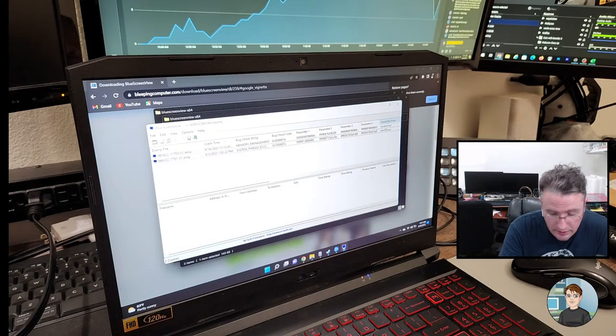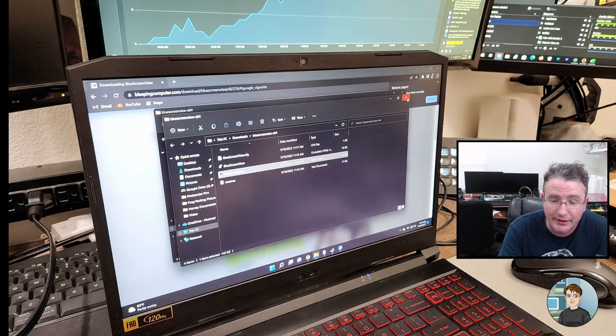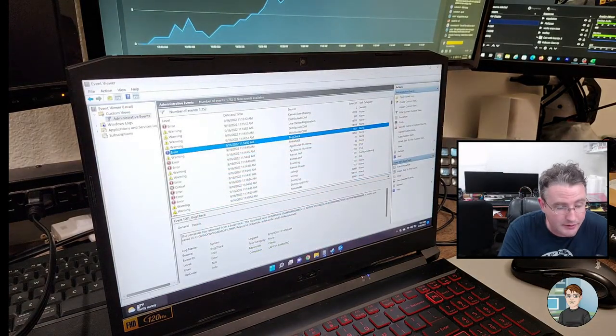All right, well, what do you think? My inclination is to open it up and reseat the RAM sticks. If it's got two. If it's got one, you know, do the one. Then we try the one at a time, that kind of stuff. Zulu, if it's getting random error messages, the first thing I would do is check the RAM. Yep, that's what we're going to do. Zulu agrees. Let's get this thing shut down.